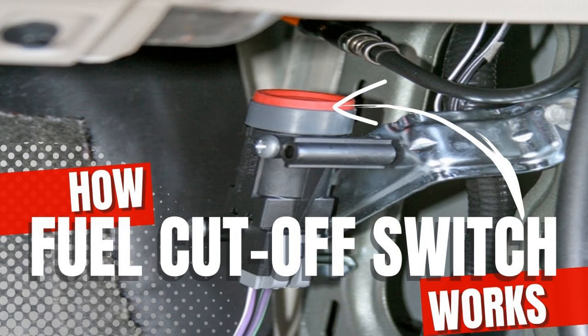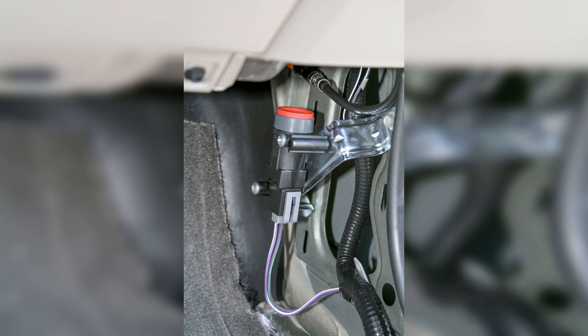Experts recommend checking its functioning at least once every one to two years. The inertia switch can be triggered by sudden braking or a collision — even a deep pothole can set it off. In some cases, automatic fuel cutoff does not lead to restoration after pressing the button, which may indicate the module itself has failed. Additional signs include noise from the gasoline pump and floating idle speeds. The electronic engine management system records each such failure as an error. The fuel sensor must also transmit information to the computer about minor changes in gasoline supply volume, and it can stop functioning due to a faulty connection with the battery or ignition system.